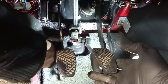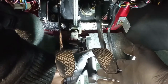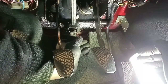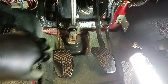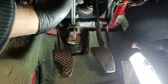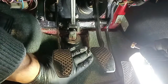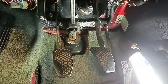So this nut is specific for this application because it is a self-locking nut, and the bolt itself may be specific because of the thickness of it. Sometimes they are. This one does not seem to be. So normally you want to push this back, but this one does not have any telescopic regulation. So what you'll do is to pull the steering box out, and in this way it will come out, I believe.